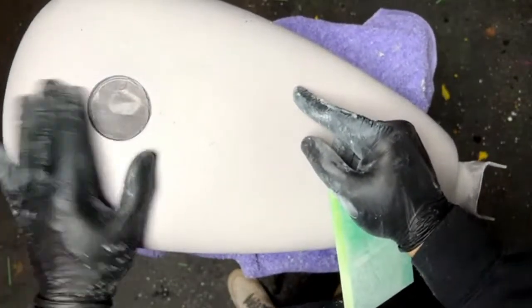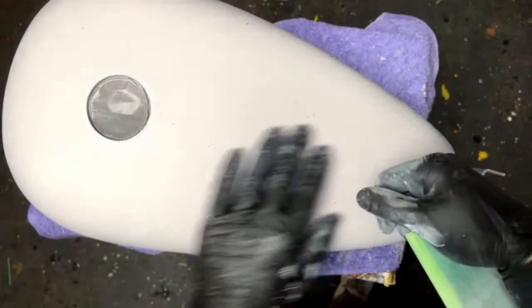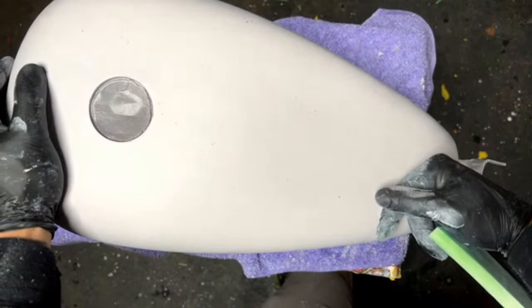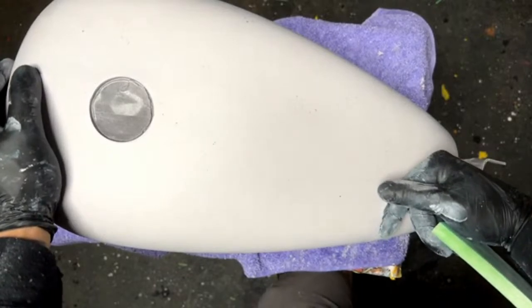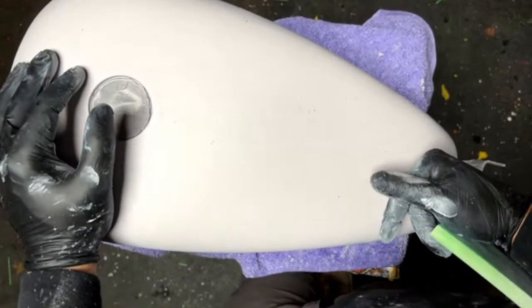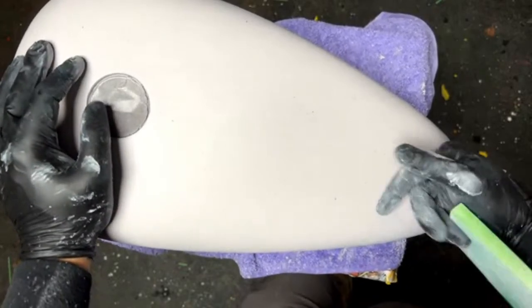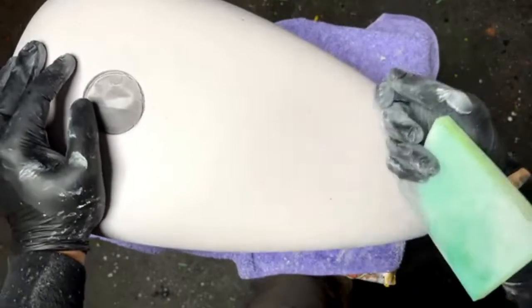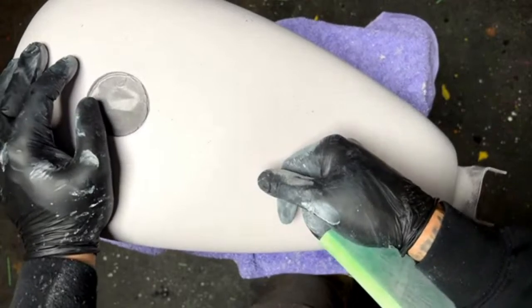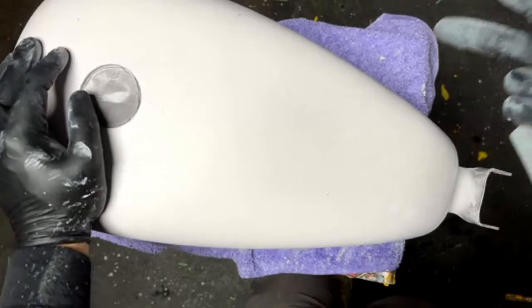That's a lot of boring stuff to talk about, but very, very important because I get so many questions about paint peeling and other issues like that. People will say, well, it peeled. I'm like, well, where did the paint release from? What was the layer? What caused it? Did it come off of the primer? Was it the primer came off the metal? If say we were to tape it later, put the base coat on it, tape layer, pulled it, and we went straight down to metal, well, we know we have some kind of problem. We could have mixed the paint wrong. Most likely it's improper prep.